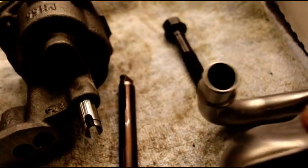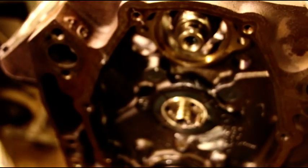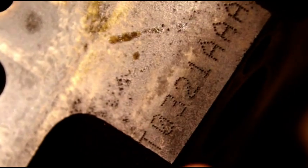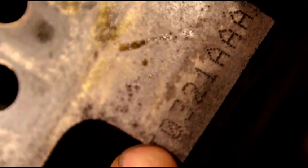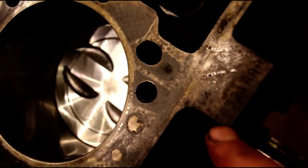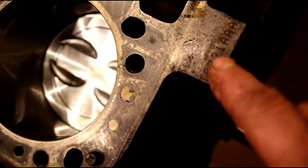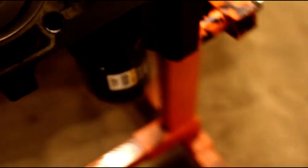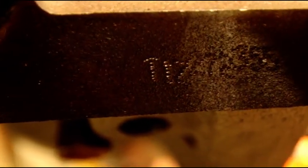Parts for this engine can be a little tricky. When you get your cam bearings, there are two different sets. In the front of the right cylinder head there's a number - you see that 'T' right there? This is a T-motor. So when you buy your cam bearings, look and see if you have that T, because it's a different set of cam bearings. With the T is one set, without is another. It's always stamped on the right cylinder head on the block. It's also on the back of the left side - you can see the T again right there.